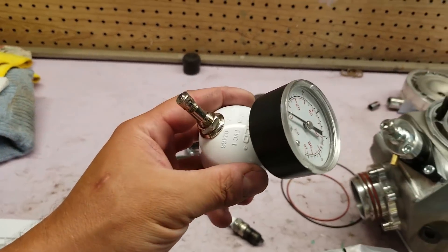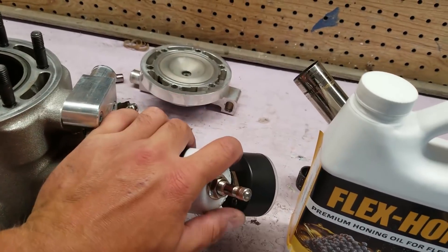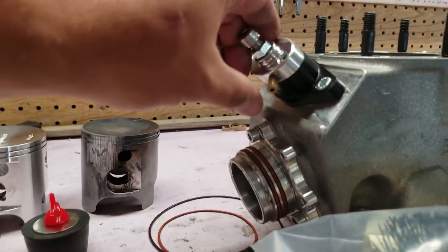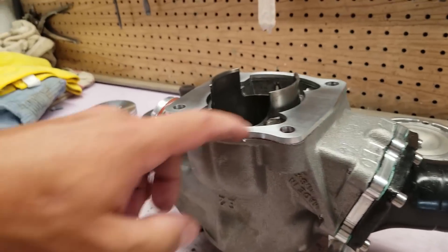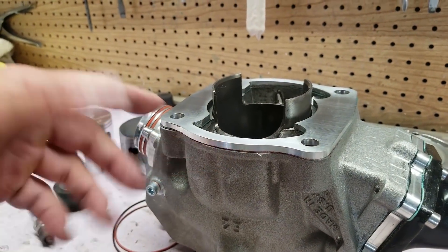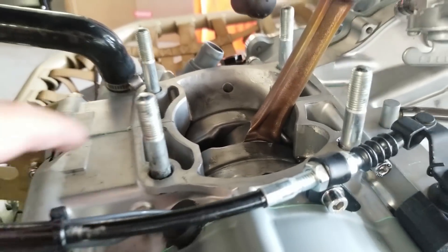I did make a little leak down tester. I had one before for the Banshee and had to kind of rig it up, but this one should work perfectly — you can see it fits right inside the boot here. On the other side I have a plug for the exhaust, and you do have to plug up the little jet on the power valve. That way we'll be able to get an accurate leak down test once we put the new top end on. I just cleaned off the gasket on the spacer plate and we're gonna be leak down testing it anyway, so if we have any leaks we can always pop it right back off.